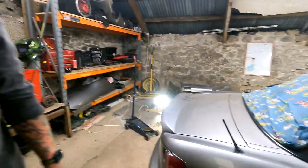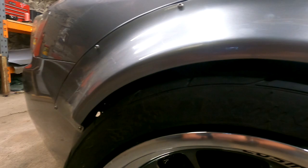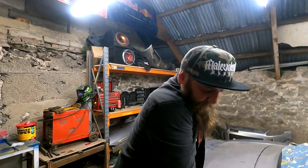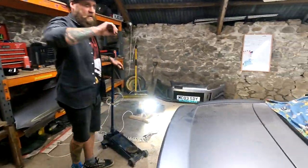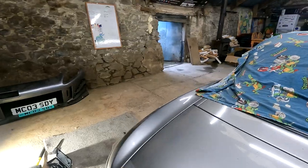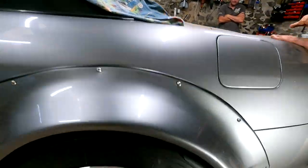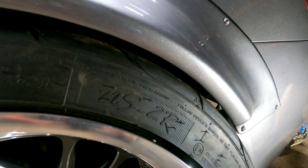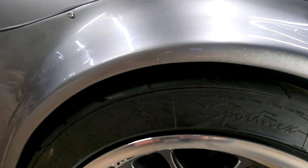I think she sits just about right, don't you? Yes. So see, it's very close, but I've stiffened up the dampening on it, so there's not so much travel. Was it you get it 8 clicks on it? I've just hardened it 2 more. Clicked it all the way to hard and then came back to 6. I'll just bring it back 2 more. Yeah, so there's not a lot of bounce in it at all. No, it's not. Just enough.